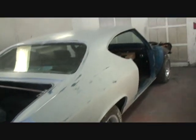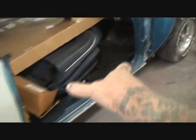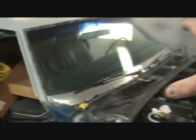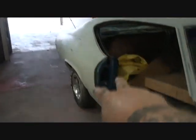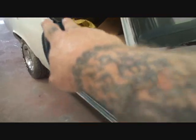We want to make sure that our muscle car makeover is going to look good and it's going to be done right. Now on the door jambs ourselves, we're not going to put any primer on that because we are going to use sealer. This is not shown on the outside of the car. It doesn't get any UV rays. So it's unnecessary to prime the door jambs and wet sand those. What we'll do is we'll back tape this here. So you don't need to worry about your door jambs as far as 2K primer goes. But once we put our sealer on the vehicle, once I show you how to do that, then we'll put sealer on our door jamb area itself to seal everything up.